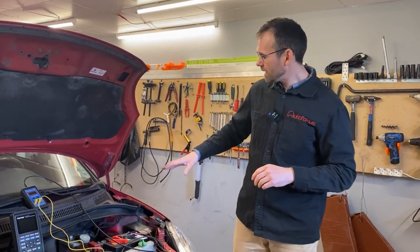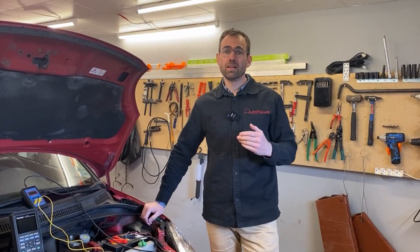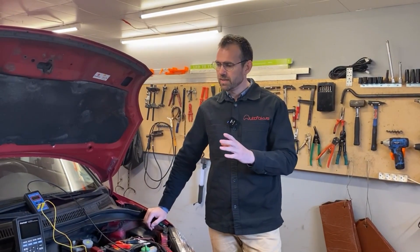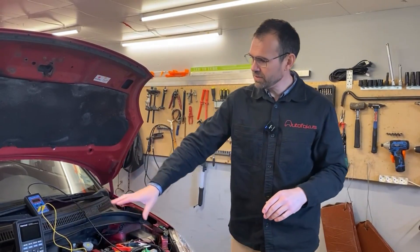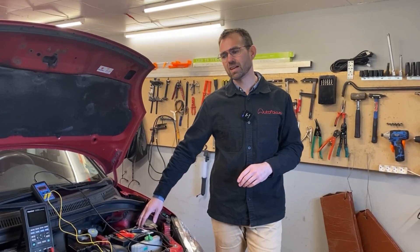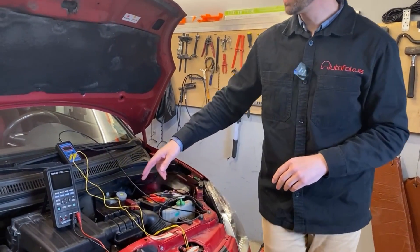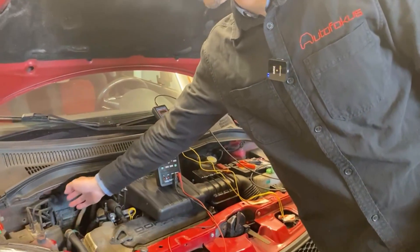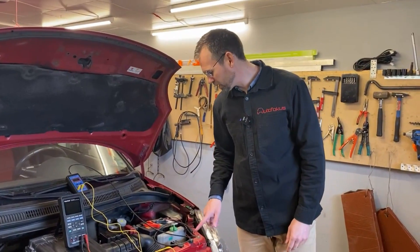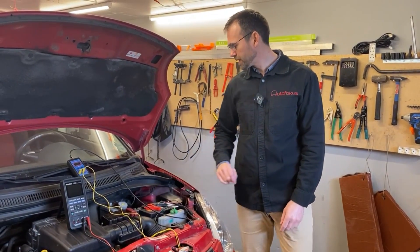Because in an old car like this you could actually suffer from multiple electrical issues due to a bad grounding. In the engine bay here you have multiple ground connections — one on the transmission box, one at the chassis at the right corner, one at the left corner, one at the front, and one underneath the battery tray.